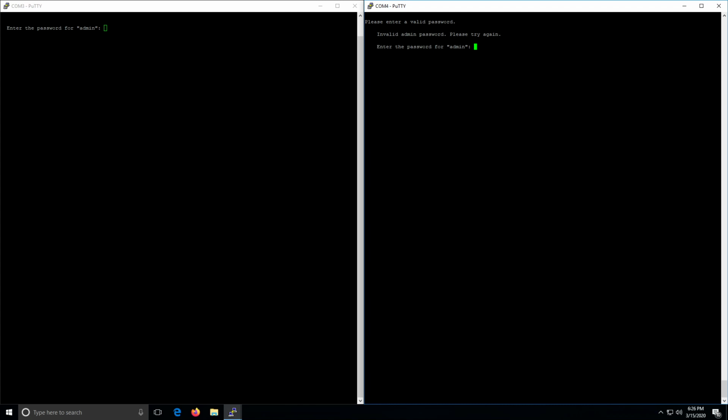The first thing is that these switches come in two flavors, and it's based on the daughter card that's installed in them. There are switches with just a layer 2 daughter card and switches with a layer 3 daughter card. The layer 2 daughter card doesn't support routing, right? So it's pretty much just switching, and you'll see a lot of the switches that have the FC features license installed will be this type without routing.